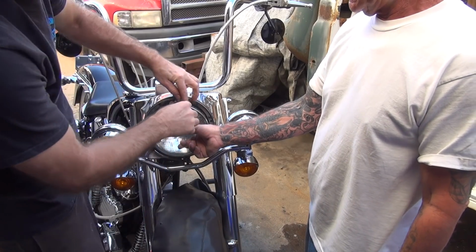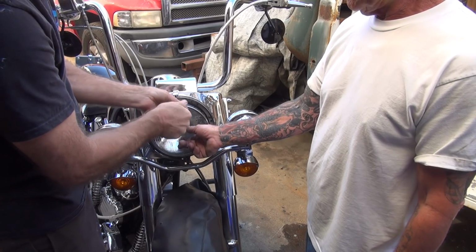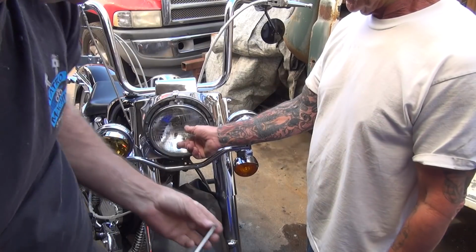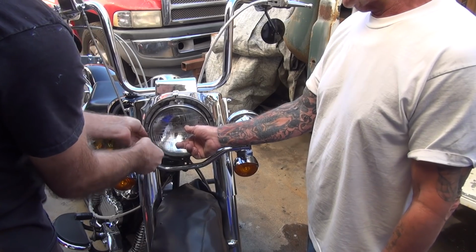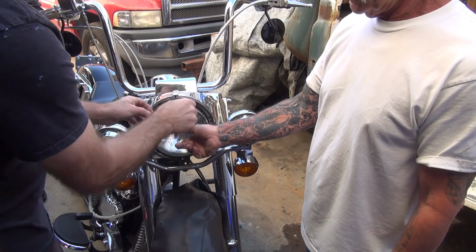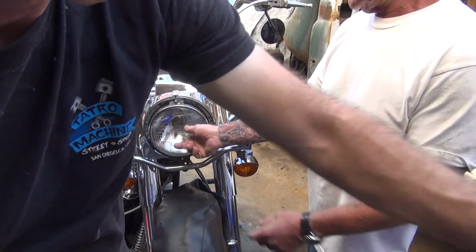So it's barely touching that connector, because when I first hit the bulb, it was on. If you watch the video, you'll see it. But it's all corroded, so it wasn't on there very good. So I gotta take the bucket back off to fix it, right? Yeah, you gotta go in there and put a real connector on the damn thing. As long as I know how to get it off now. Yeah, if you pull this bucket out, the whole thing will pop out. Then you got a big access hole. Right, I don't have to take this off again.